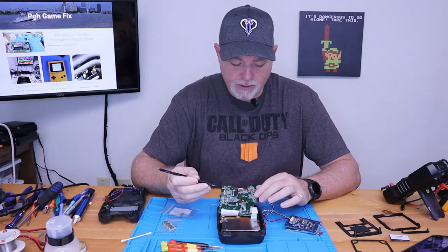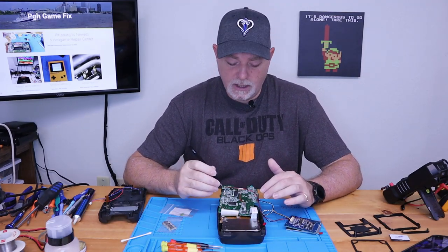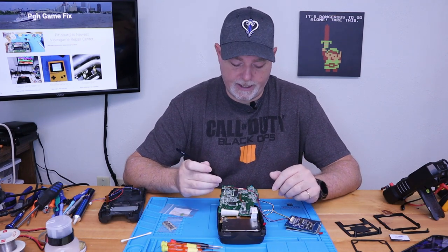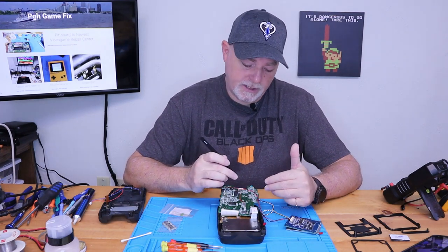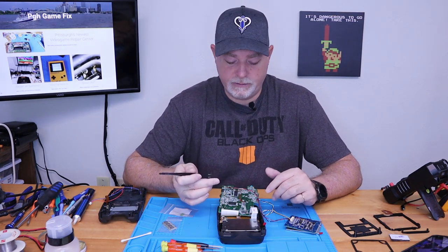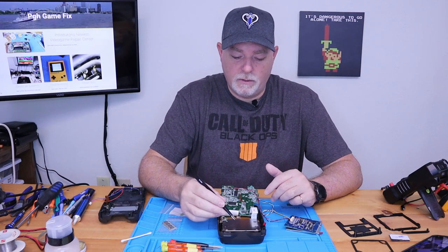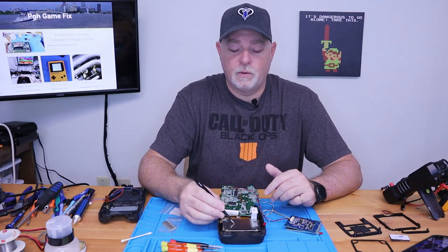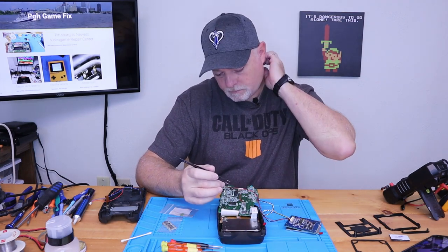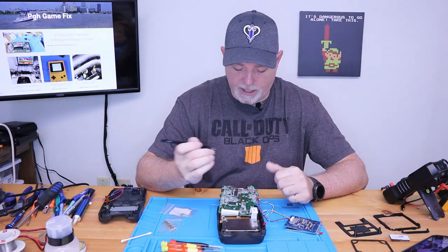As previously mentioned, we had no 5 volts, we had no 29 volts. Both of the rails were basically shot. There was damage to the 5 volt regulator system that we couldn't track down. And we were unsure if the original LCD was shorted out or if there was a problem with the actual backlight or the backlight circuitry, although everything checked out.